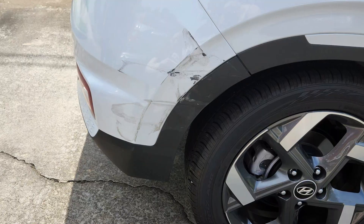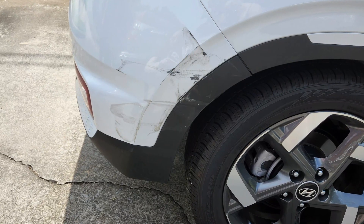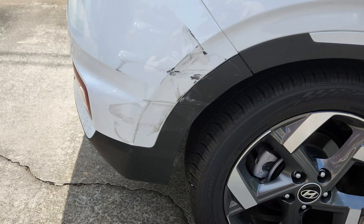It's not uncommon to see this parking sensor error or blockage message when your car was in a minor accident — if the front or rear bumper was hit. Even if you don't see any damage, even if the bumper looks okay, it can change the position of the sensor or affect the sensors themselves. Of course this wouldn't be covered by warranty, but at least you'll know what the problem is.